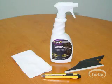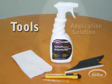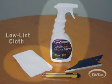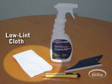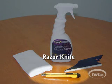Before you begin applying your film, make sure you have the appropriate tools for the job. The Gila application solution is recommended for use throughout the application and cleaning process. A low lint cloth should be used to avoid any contamination of the adhesive with dirt particles. The razor knife with breakaway blades is used for film trimming, and blades should be changed after each window tinted.